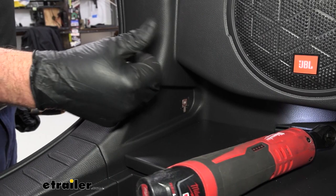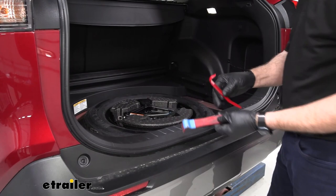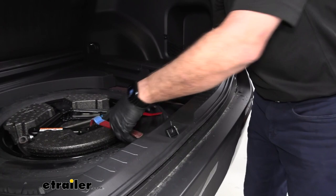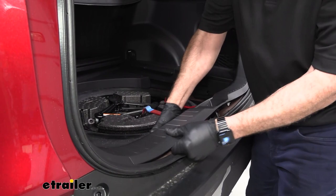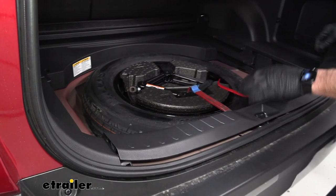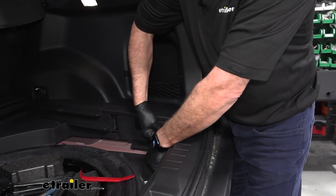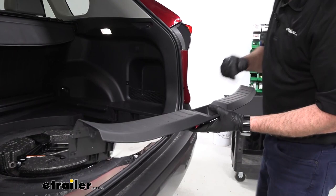Go ahead and do that on the other side, on the passenger side as well. Now this next section is the center section and it's just held in place by pins inside. We have plastic trim panel tools available and these will help you out. Sometimes these come up pretty easy and sometimes they don't, so just take it and start wiggling while you're pulling up. Apply some upward force at the edges to pull it up — it comes straight up. You can see the clips here that are holding it down. Go ahead and set this off to the side.